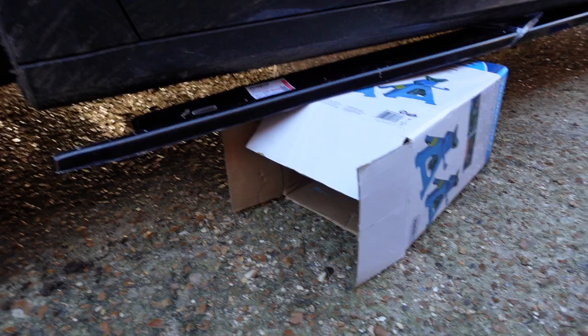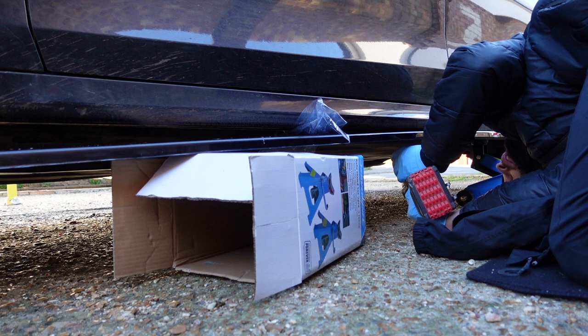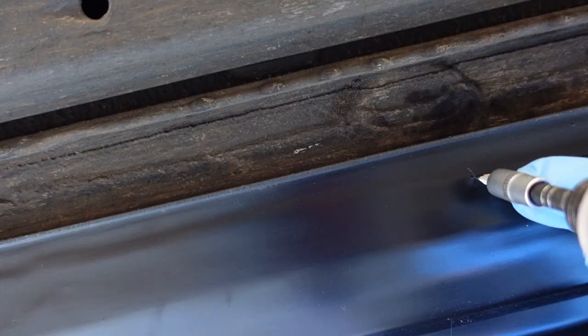I'm doing it on the inner section here and then just going all the way along. Do it on your own — get a box or something like that, makes it easier. You don't need the pilot bit because these are self-drillers; I only used the pilot bit for the first hole to make it easier to get in. Right, you can go under there now — bosh.